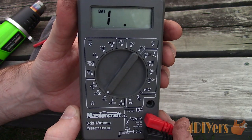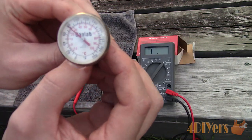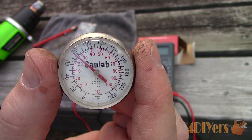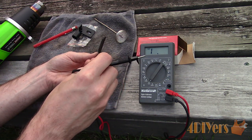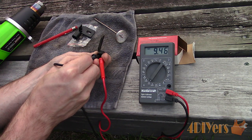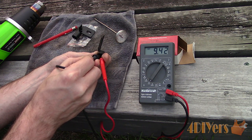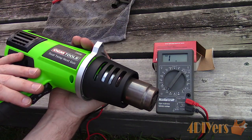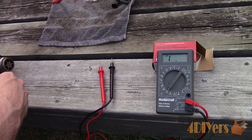As for testing the sensor, you can measure the resistance and there is a specific value based on the temperature it's exposed to. I have a thermometer here as a reference — currently it's about 26 degrees Celsius or 79 degrees Fahrenheit. Set the multimeter to the 20,000 ohm resistance setting and touch the probes on the terminals inside the sensor. We are looking at about 9.45 kilo-ohms. A heat gun can be used to test the temperature at 55 degrees Celsius or 130 degrees Fahrenheit. For this I am using my dual temperature heat gun made by OEM Tools, model number 24498 from Mobile Distributor Supply.